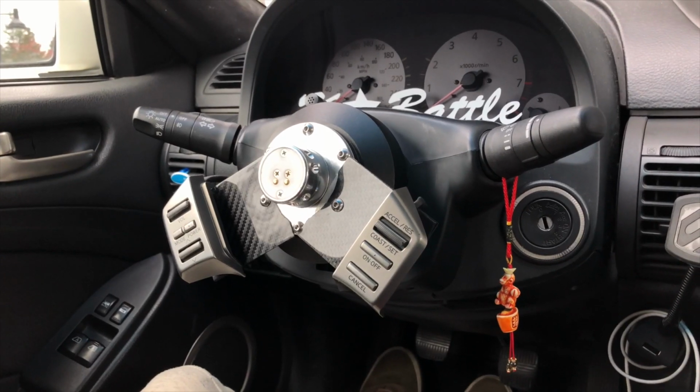You want to make sure you have some safety goggles. If you have a face mask, I would do that just because the carbon fiber gets very powdery when you start grinding it, so if you don't, make sure you're in a ventilated area. But even then, I would recommend having a mask. I don't have one, I'm not going to use one, but just as a warning for anyone who wants to try this.